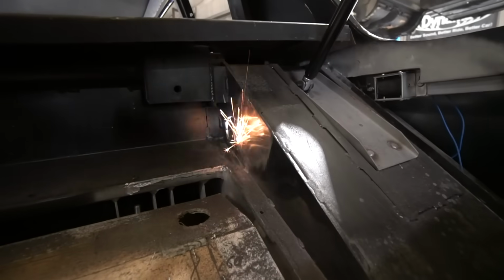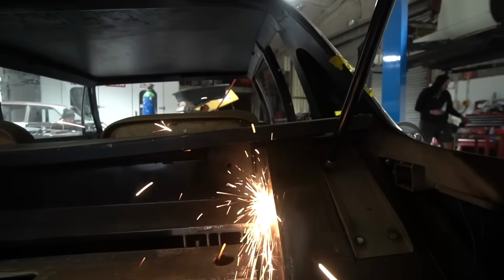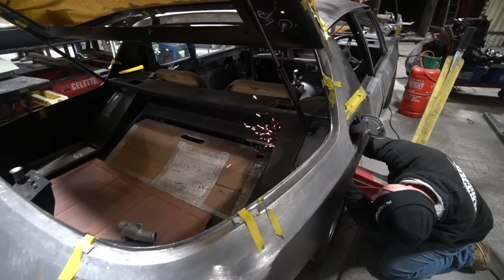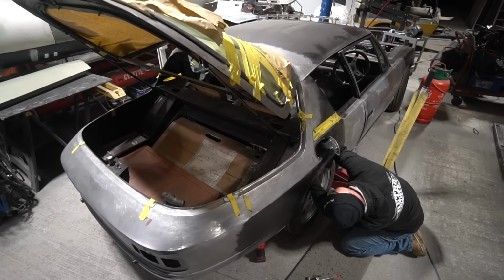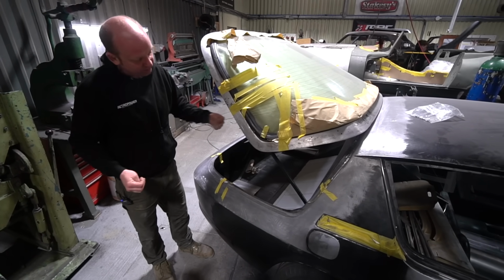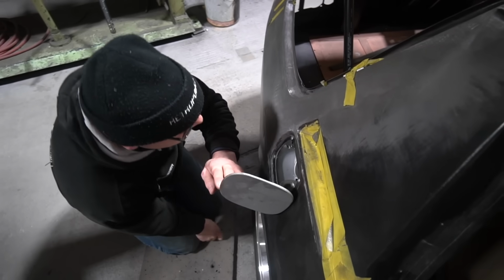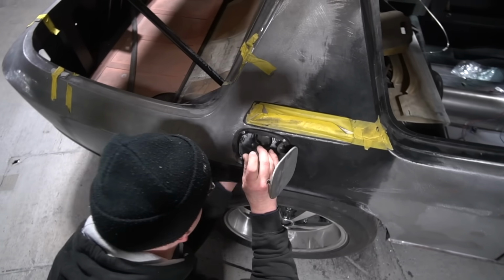But that does leave the tank breather, not the breather that breathes the tank while the engine's running, but the breather to allow you to fill the tank without it airlocking. That would be from the top of the tank, obviously, to let the air out, but it needs to present the air to the upper part of the fuel filler neck. And that kind of almost meant it needed to come through the car. Now, Stu's found a little gap where we can get from the top of the fuel tank out through the chassis side blade, or through the sort of upper chassis rail, if you like, we call them a blade, through that and then up and into the top of the filler neck, kind of in this area here.